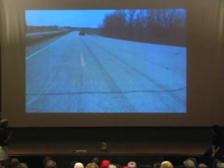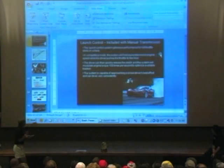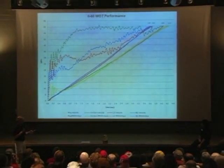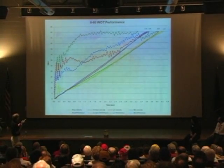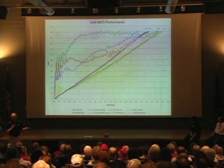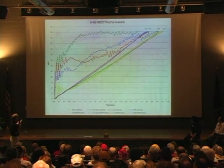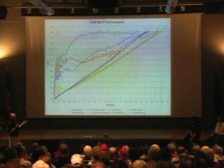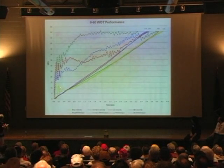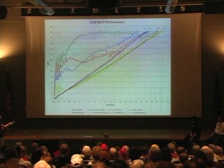Since I'm an engineer, I'm going to show you a graph and go back to the presentation. I'm going to show you what this means in terms of actual performance. What we have here is those runs that you saw — just those four runs. The squiggly lines that go up are the speed that the rear tires are going, and the straight lines are the speed of the car — or you can think of it as the speed that the front tires are turning. When these lines are above these lines, that means the rear tires are spinning — they're going faster than the front. Here's the first video we saw — this is a bogged start. You've got a little bit of wheel spin at the beginning, then it hooked up, and then the front and rears are going at the same speed all the way out.